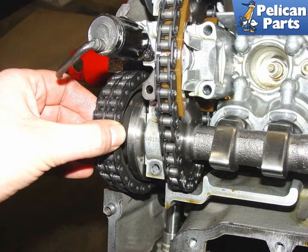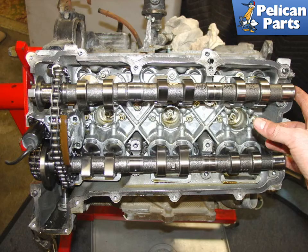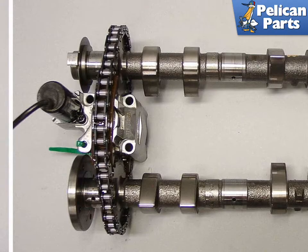Be prepared at this point — the camshaft can actually fall out of the motor, so be ready to catch it. With everything disconnected, remove the camshaft timing tool from the engine, remove the camshafts, and move them over to your workbench. Shown here are the two camshafts, the small timing chain, and the VarioCam tensioner that ties them together.